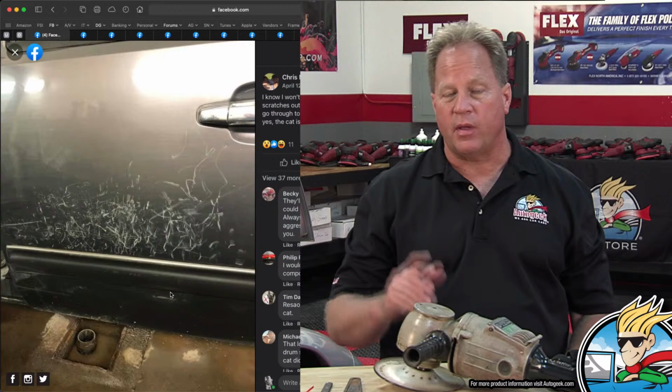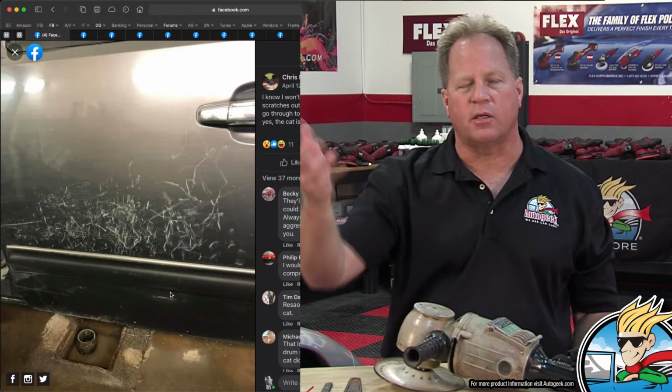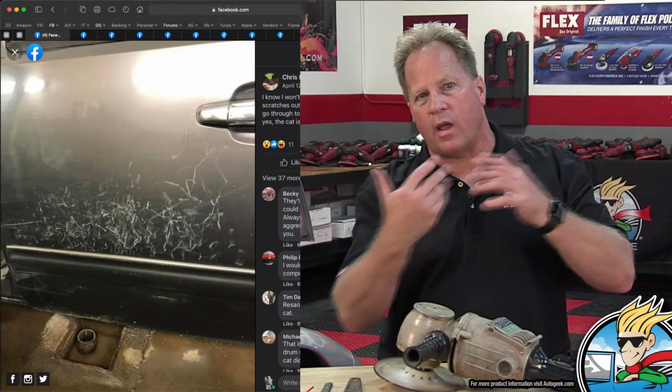And one of the things I teach people about stuff like this, before you start working on it, to scare you a little bit, take it to a body shop and say, how much will it cost me to repaint this door? And they'll give you, just ballpark, $300, $500, okay? Now, once you got that number in your head, now it's real easy to go, I'm just gonna hit it with 5,000, like Mike said, and buff out. I'm not gonna be the god of wet sanding and try to wet sand that with 1500 grit and work my way out and compound it, because I'll guarantee you, you're going to be buying a paint job.